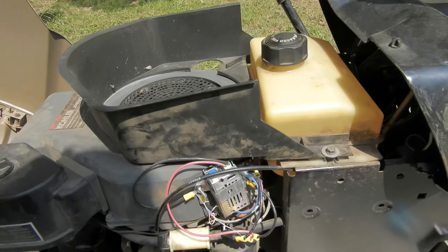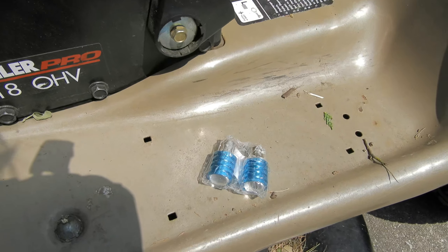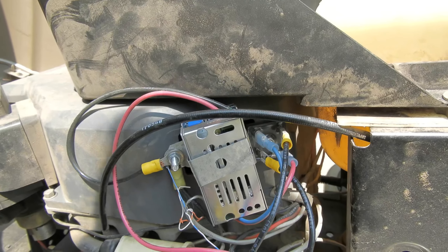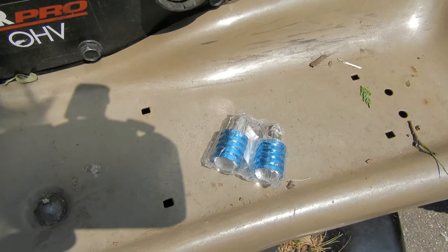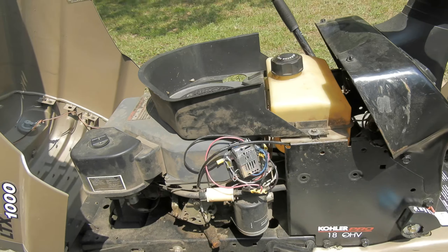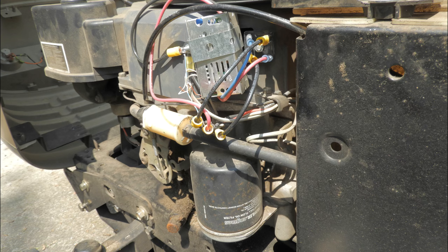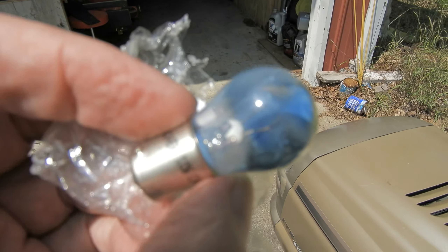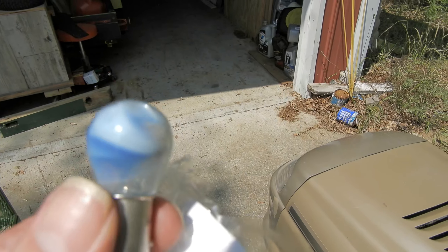The whole purpose of this, if you haven't been following my saga on this, is to be able to run LEDs without burning them out. In the winter the voltage gets a lot higher when it's cold on the traditional regulator — that's on purpose to keep the battery charging, but it fries out my LEDs. Problem resolved I guess. We'll see how it goes. I've always got the stock regulator I can put back in. The old regulator wasn't too kind on traditional bulbs either, but at least they're cheap.